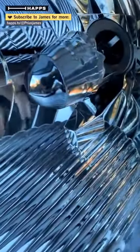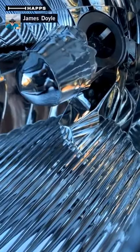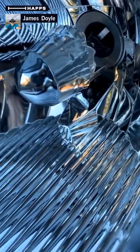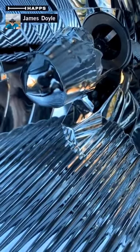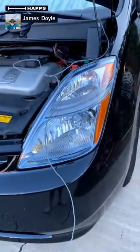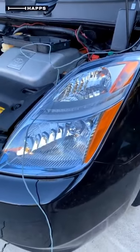Underneath here, this is the cap that goes over the bulb, and underneath there's another piece. You can see it changes color and has a jagged edge underneath that silver cap. That's an inner cap lining that slides back and forth — that's called the shutter. It covers the bulb more or less, and that's how the high beam and low beam work. So that didn't work.